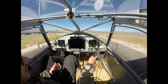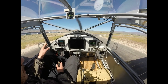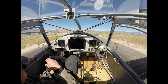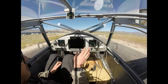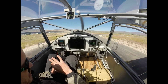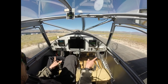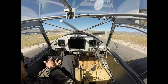As you can see, we actually have two meters in now, so we have a split exhaust that is allowing us to monitor each carburetor individually. We're seeing that even though each carburetor was adjusted identically as per the suggestion — even though I'm well outside of the suggested jetting and adjustments — everything is always assumed to make equal adjustments to both sides. But we can see that we're actually running about a point rich on the right relative to the left.